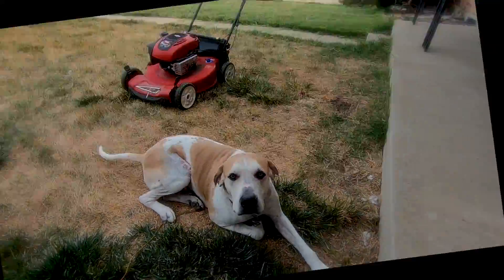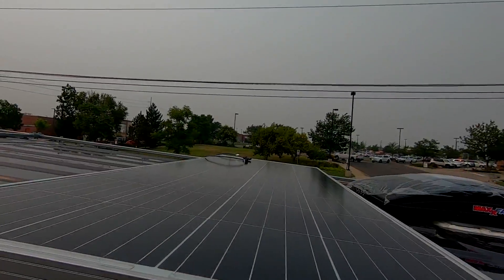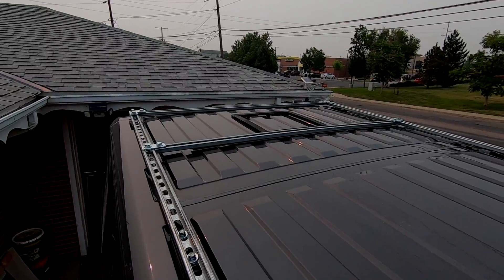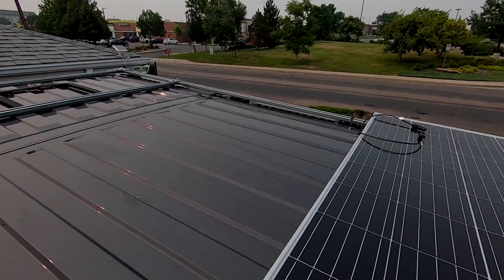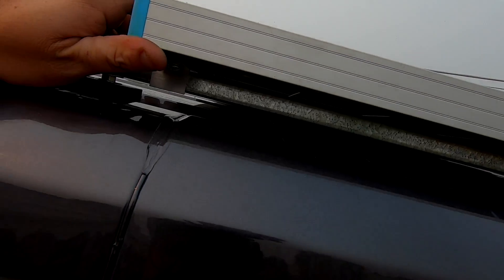I'm back — it's been a couple of days, but I got the roof rack done, so let me go up on the roof and show you that. Here's the roof rack. I put in some crossbars — there's one right there and another one, and the panels are going to fit between the crossbars, three of these guys. It's pretty solid. Let me show you how I'm mounting these solar panels. You can see right there is a bracket I built — angle aluminum, and another one. There are two on the other side. I haven't bolted them down to the roof rack yet, but let's go take a look at the brackets I built.